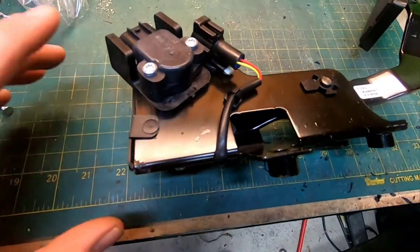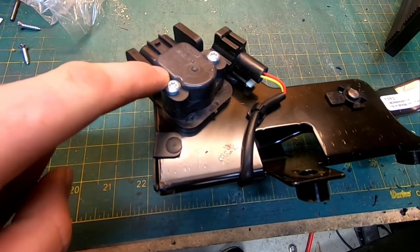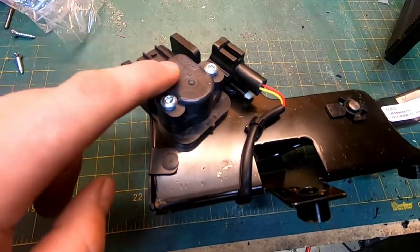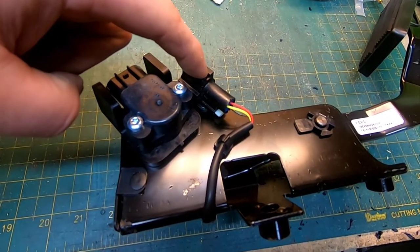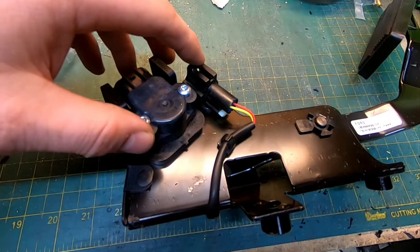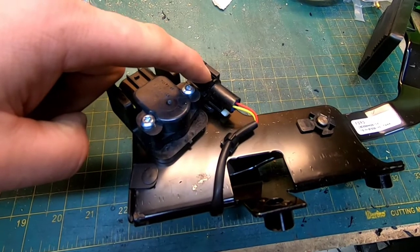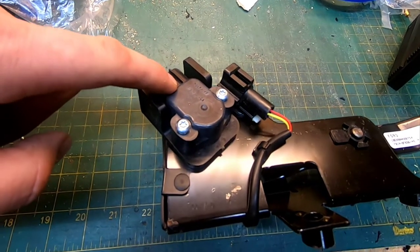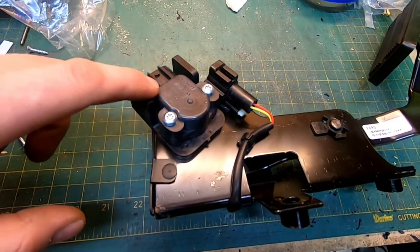I want to go over this one more time because it's really important that you understand what happens when these sensors fail. The throttle position sensor tells the computer exactly how far down the pedal is and controls the RPMs of the engine. The other sensor is only to tell the computer if it's in idle mode or not — basically saying whether the accelerator pedal is being depressed or not. When that sensor fails, you basically won't be able to move; the engine will just stay idling and you can press the pedal all day and nothing will happen. When the throttle position sensor starts to fail, you usually get jerky responses or dead spots in the pedal. Those two things you need to understand to diagnose your problem.